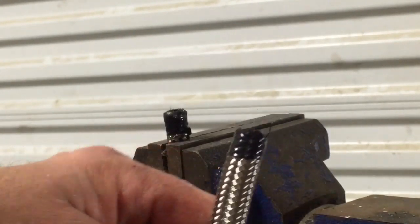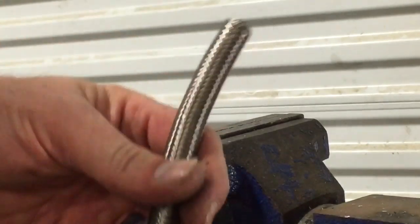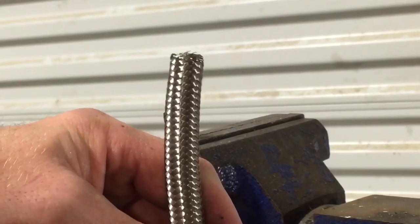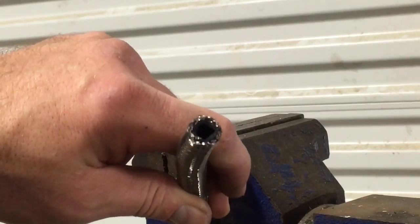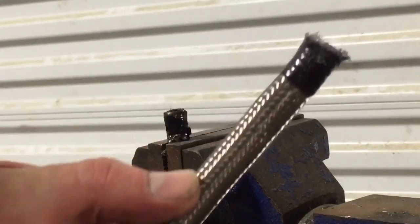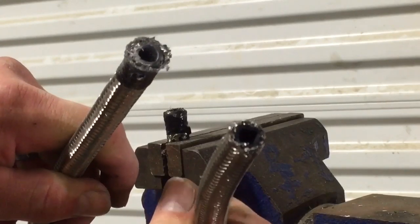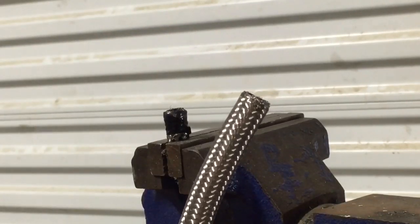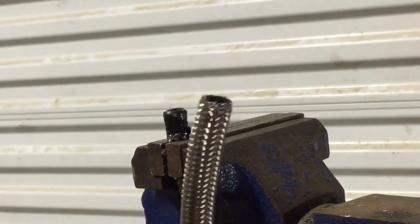Tape is off — that end is not flared up at all, looks really good. That's the best way I've found to cut it. There's no debris down inside like there was with the hacksaw. Get yourself some Klein cable cutters and cut your braided steel line, making your rounds around it just like I showed, and you'll see the difference.